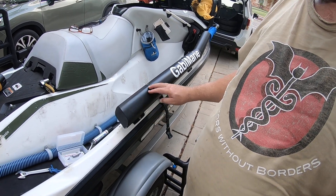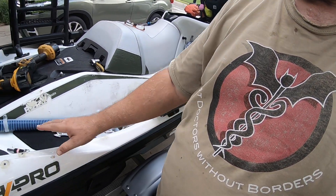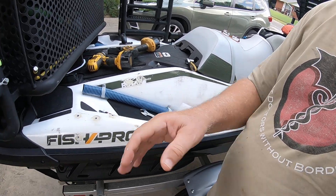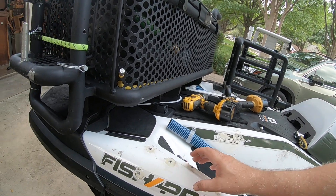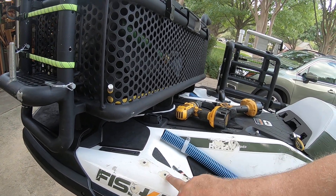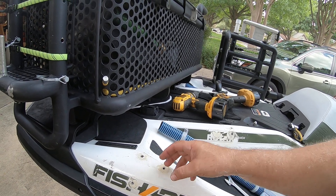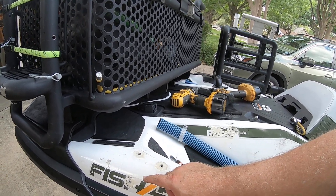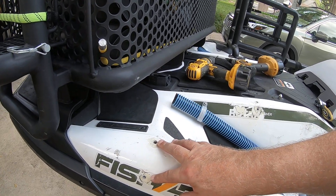As you've probably seen in some of the earlier videos, I have racks and rails attached to my ski. These are attached directly into the frame of the fiberglass body. I did start using six millimeter helicoils, but they sometimes strip out or wallow out. So what I'm doing is putting in a special fastener called a rivnut.